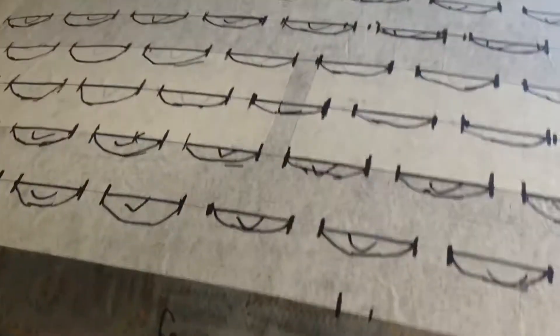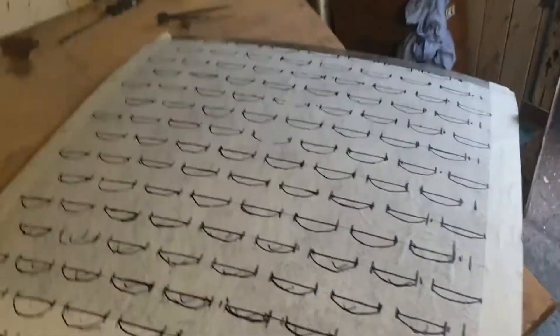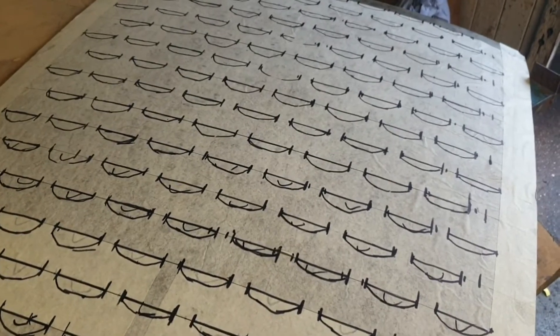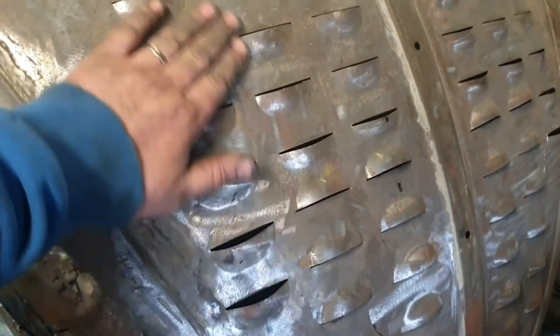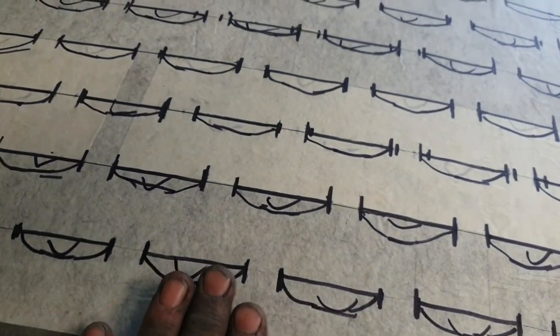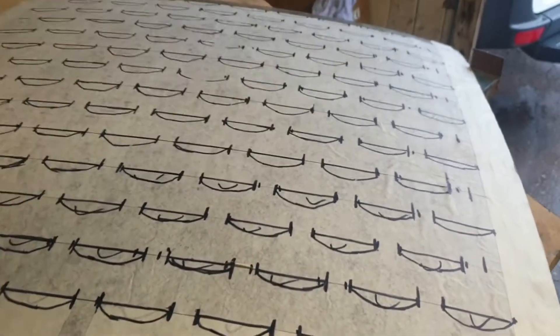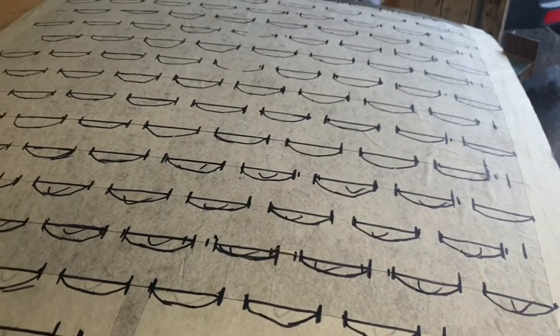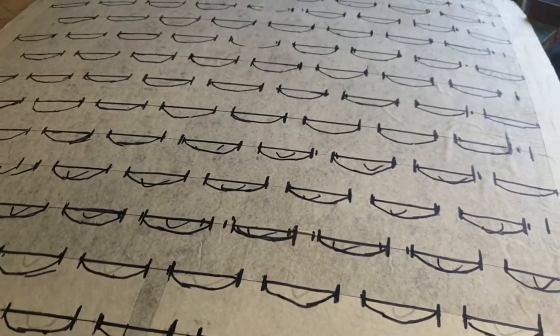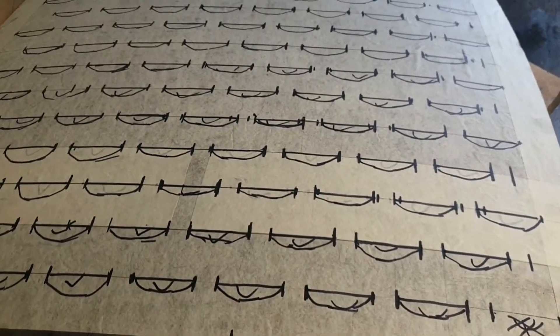There you go — look at that. This is the front and the louvers are scalloped in that direction, and there's a lot of them. It's the world's biggest cheese grater — and that's going on the roof up there. All of these scallops: the air is going this way as it goes up, so it's not coming into the vehicle, it's just a hump. The same on the roof — the scallops this way, not coming into the vehicle, just a hump. All the way down the car there'll be humps. From the back there'll be slots. And if I happened to have an accident and a deer jumped out in front of me, it'd just bounce off the top — not end up inside the cab completely shredded. I'm going to start cutting these now with the disc cutter.